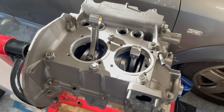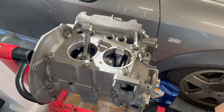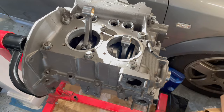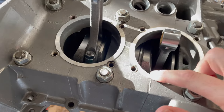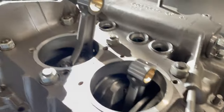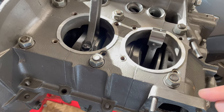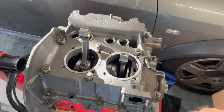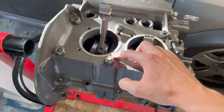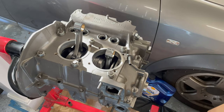I've been working off camera here. I could not get the crankshaft to spin properly in the junkyard case I had, so I went and bought this new case — new for me, but it's 40 over. It has proper cylinder surfaces, it's also full-flowed, and it looks insanely better. I got the crankshaft to sit properly and torqued it down, but when I got it to only five foot-pounds it already binds — it's completely stuck.